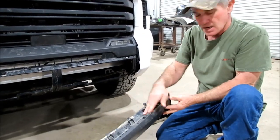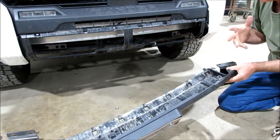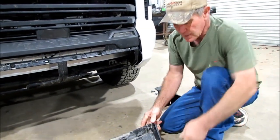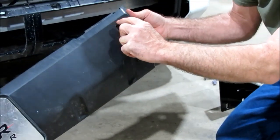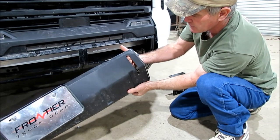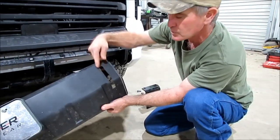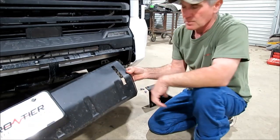So that's why you've got to pull those loose right there. To get this guy off, you can see the little series of tabs right here all the way around — these push in and slip out on that bottom. Work the bottom ones first. These little tabs have to come loose to be able to get this piece of plastic off. When you get the piece of plastic off, you're going to have your white line, or whatever you used, as a little border. From the top of that line on the back side, come down a half inch to three-eighths of an inch — that's where the top of your cutout is going to be. From that line, come down another five inches and make another line, then bring this line over three-quarters, and that's what's got to be cut out. We use a little cutoff wheel, but you can use a utility knife, Dremel, or whatever you want — that needs to be cut out for your bracket to protrude through.